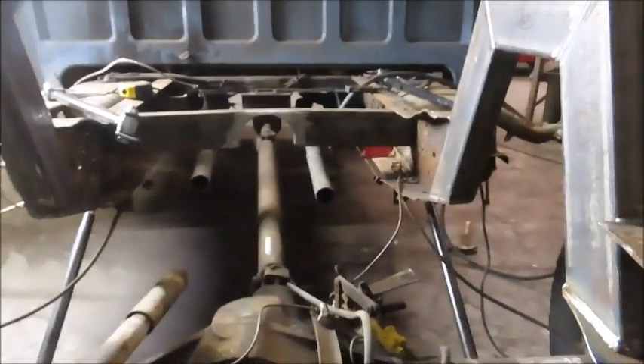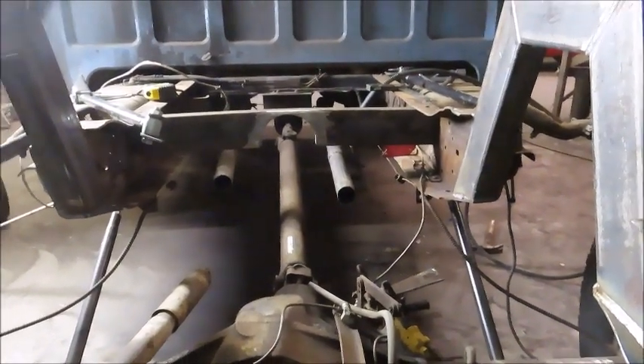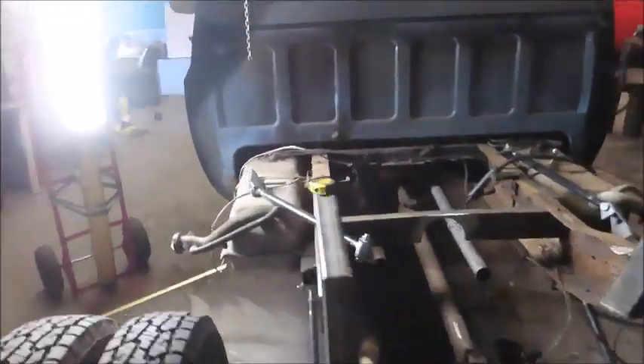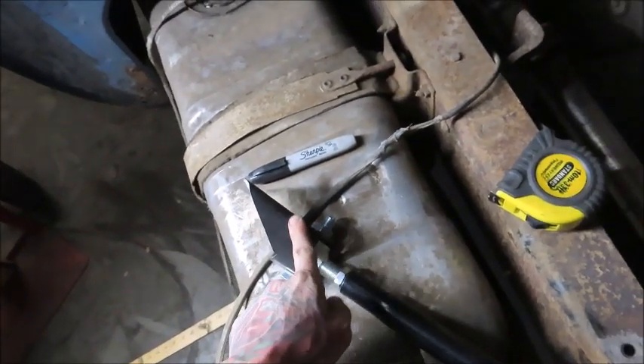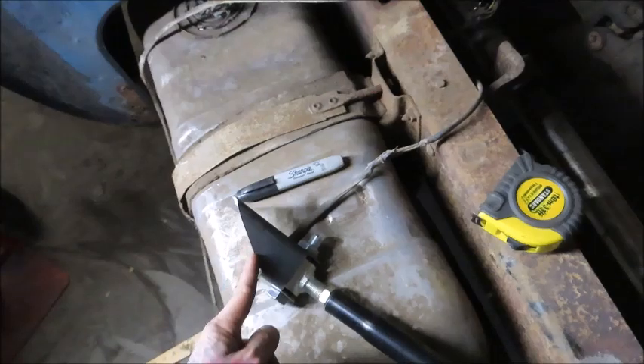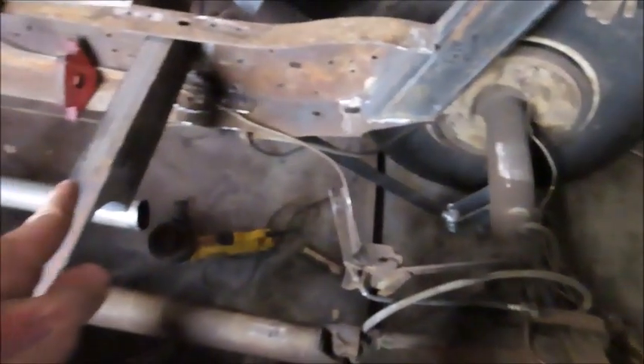I've built my crossmember, notched it, and gave room for the drive shaft. It's now tacked in place, squared up, all that good stuff. Now I can mock up these four-link bars. I'll have to clean off these areas — same spot on that side — and then clean these. Then I'll have to find the angle that I need to cut on here, because this angle here is not going to work. So what I'll do is tack those in place exactly where I want them, find this angle, cut it, tack it in place, and do the same exact thing on the other side.